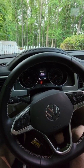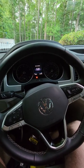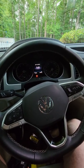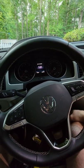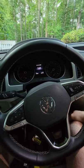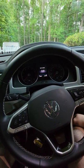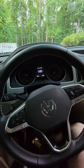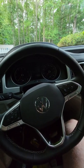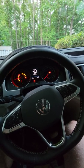Now, if anybody has this keyless entry after doing any of this, just let me know. If anything, the computer might have found, hey, wait, why is this disconnected and we still have battery connected? Again, the battery is still connected. I did not disconnect the battery for this because I wasn't doing anything contacting the pins. All I did was put a zip tie on and push the rubber back over and reapply a little bit of dielectric grease onto the outer rim of the face. So, it's on.